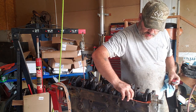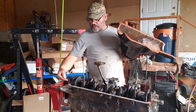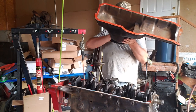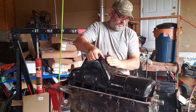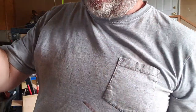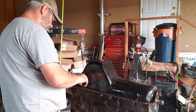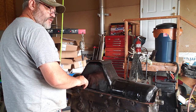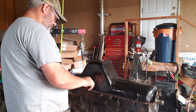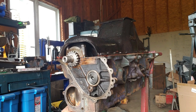You don't have to worry about the front of the engine here because the timing cover handles that. Oil pan has a light film of silicone; I put a bead on the corners around the rubber seal where it meets the gasket. We are ready to go. It certainly makes life easy when you label all your bolts. You want to start these by hand — they don't take a lot of torque, so if you use an air tool or driver, just be very careful you don't go too crazy. The oil pan is only on loose right now.